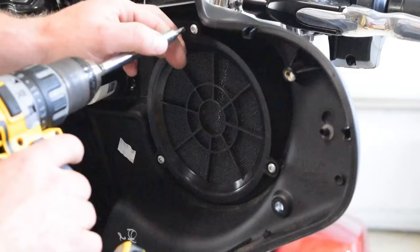Okay, this one is now done. I have the wires protected with heat shrink, and that is because this is in a motorcycle. I need to keep moisture and corrosion down, if possible, on these connections because I'm not soldering them. Anyway, we have that done there. I am now going to do the exact same thing with the other channel, which is the speaker on the other side.